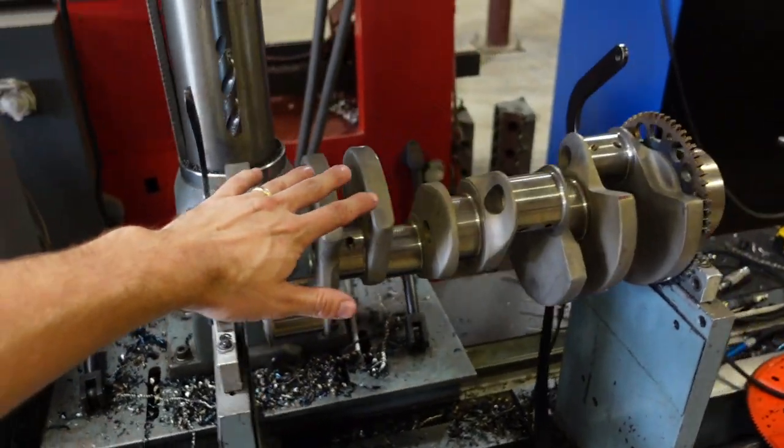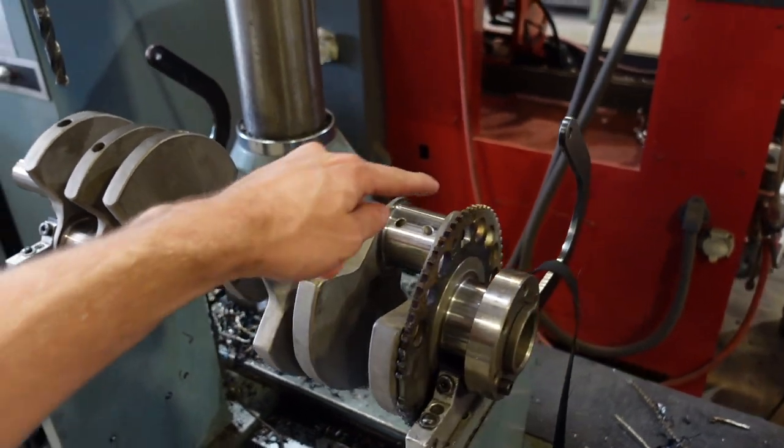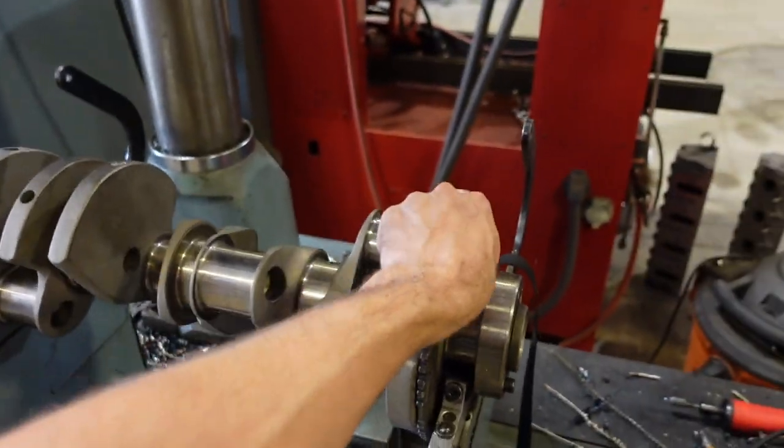A motor is only as good as its foundation. So for this build, we're going to be using a brand new GM aluminum LS3 engine block, and we're going to fill that block with our fully forged Smedding LS rotating assembly. The crankshaft is obviously going to be one of our 4-inch stroke 4340 forged cranks. It's going to run a 58X reluctor for high RPM accuracy.